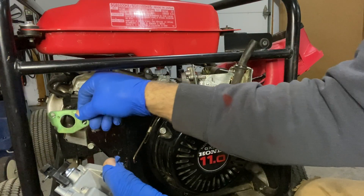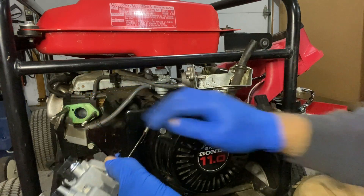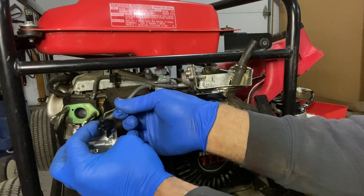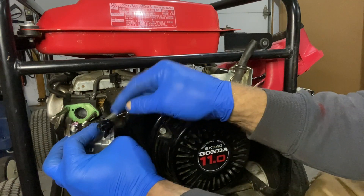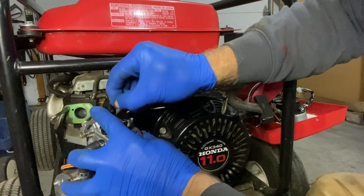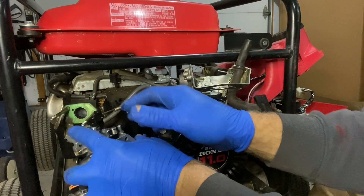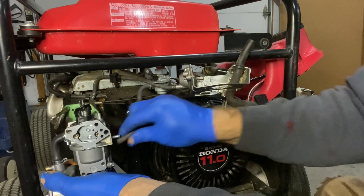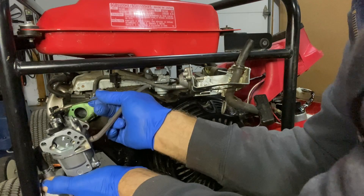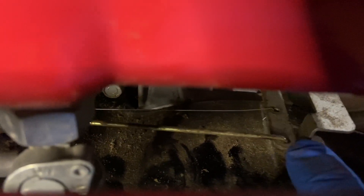Make sure you order a gasket when you order this carburetor. I'm going to set the gasket on here first so it doesn't have a chance of falling off and getting damaged. Now we're going to put the governor linkage on — you hold it like this, slide it down in that hollow, and then this whole thing turns. Now we've got to hook the spring up — it just goes in there. Needle nose pliers would make that job easier. Shove that on, wiggle it into place — your spring goes in that little hole on your governor linkage. Make sure everything runs smooth.